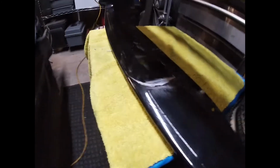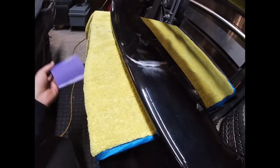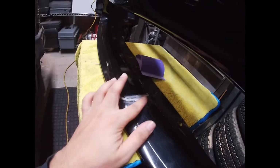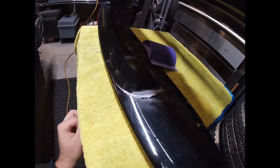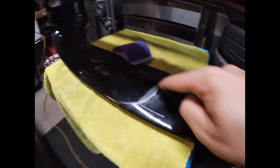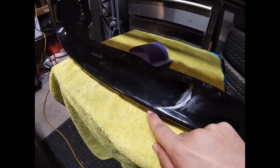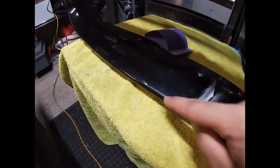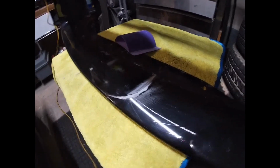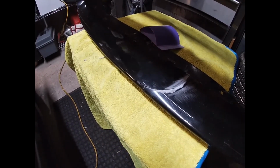As you can tell, I'm gonna start sanding it. I just tried to see if the 180 would work directly, but I think I'll have to start with 80 grit straight. So some of the filler did come through, but that's okay because it did fill the crack fairly well. As you can tell, my crack starts all the way at the edge. It comes all the way around to the bottom here, and did spread some all along there as well. So I'm going to sand this whole area down, mix up some putty, and I'll be back.